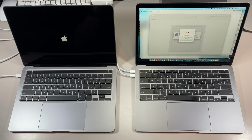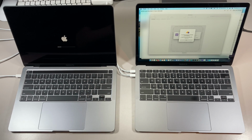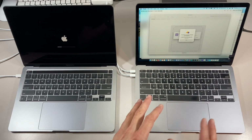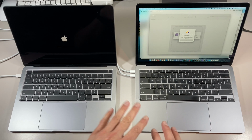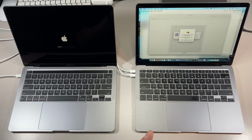This is an error you'll get if you're running an older version of Apple Configurator 2, version 2.13.1, if you try to click the restore button, because this version is not ready to download macOS IPSW files from Apple yet. You'll also get this if you're trying to put an IPSW file that's not compatible with this version. For example, if you had an old beta version of the Big Sur IPSW that did not have all the pieces needed for Apple Silicon, this is the message you're going to get, because it's going to check the plist to see if this device ID is in there, and if it's not, it's going to immediately reject it.